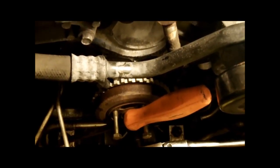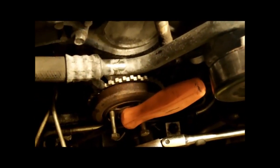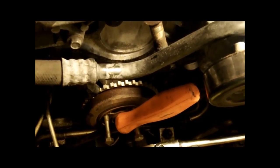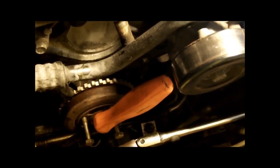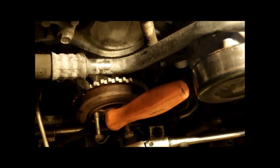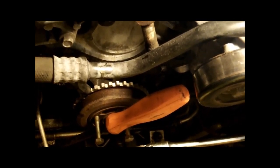I've got the 21-millimeter socket size bolt broke loose on the crankshaft on the harmonic balancer. I stuck two metric bolts — not from my engine, grade eight — screwed into the holes enough to allow me to stick a pry bar in there to prevent the engine from turning over while I use my long locking flex-head Snap-on half-inch drive ratchet with a 21-millimeter deep well socket. Never use your engine hardware for tooling — just get some bolts. Bolts are cheap; engine parts can be expensive.